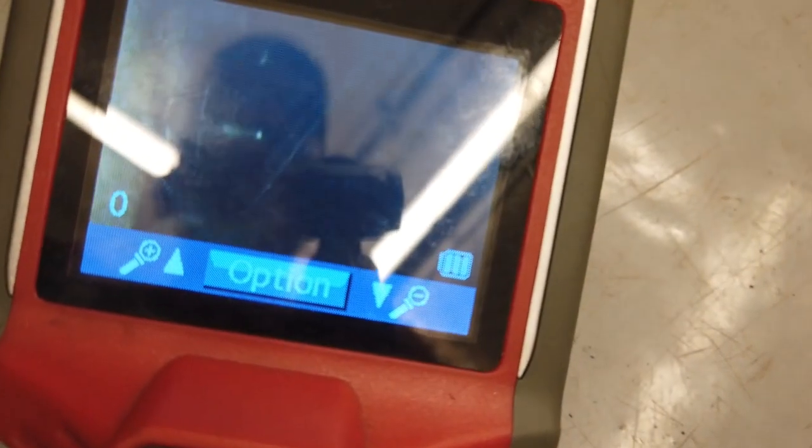I wanted to see how the wax oil held out all those years. You can do a memory card on this camera, but I've got a camera inside the sill and we're looking to see if it's dry and rust free. You can see the seatbelt bolt there. I can see the old yellowy coloured wax oil, clean metal. I'm not seeing rust. Go a bit further in. Very dry, ready for another coating, I reckon. Nothing's rotten in there.